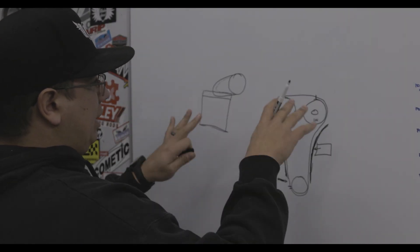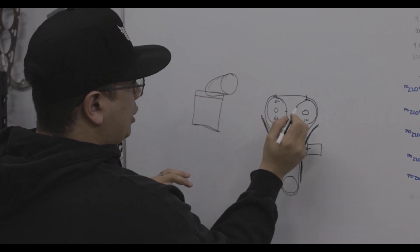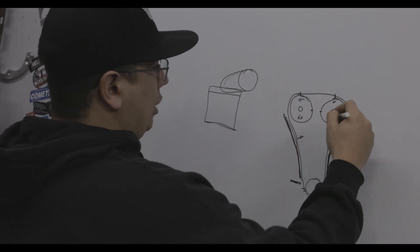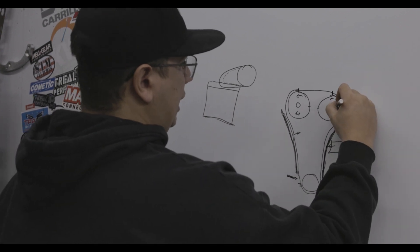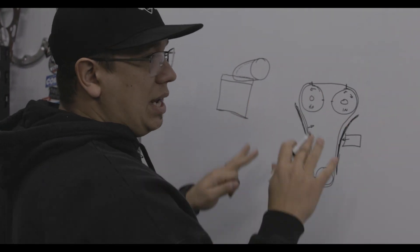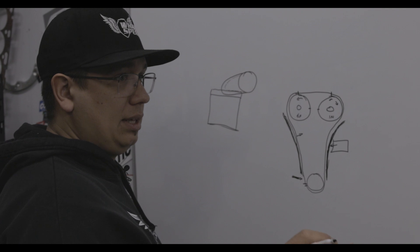This is probably what's causing a lot of trouble for people. You set the gears in, set timing, and then look at the gears and they're off — because the camshaft just happened to rotate the exhaust gear one direction and the intake gear another direction, putting slack in the chain. What you do is, with everything locked, rotate your intake cam to pull the slack out of the chain, and then the gears should rotate into the correct position. If left in the resting position, the engine is not timed correctly.